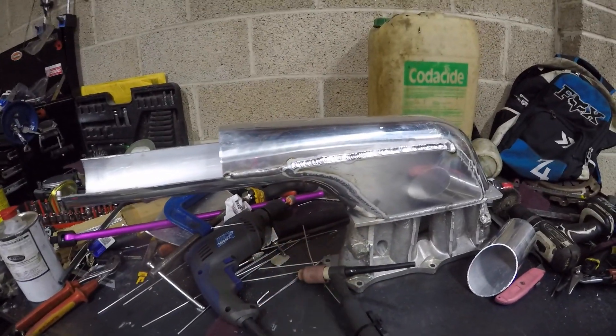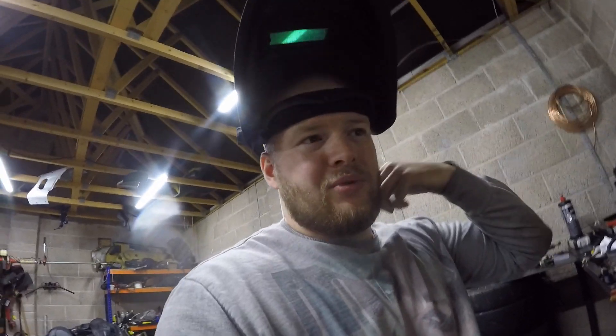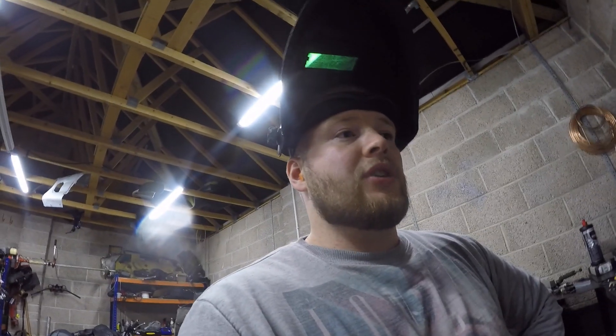What I've done now is cut out these plates — they'll weld over the top and act as the inlet trumpets. I can see a couple of splatters there but the majority of it looks okay. I've probably got to chop it about there for welding on the flange for the throttle body. I'll keep it 76mm, just in case I need to future proof it and put like a 70mm throttle body on, but the 65mm standard one should do for now.